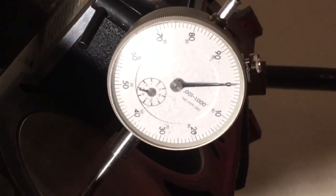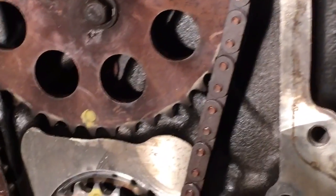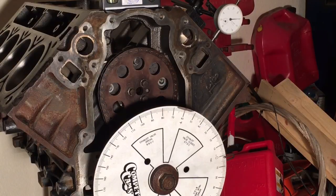Here's my dial indicator set up on the piston, and that's at a true measured top dead center, dead on. We've oriented our degree wheel to zero at a true top dead center. Basically, all you have to do is bring your two dots — your dot on your cam gear and dot on your crank gear — together like you normally would. Set up your dial indicator right on top of your piston, as close to the center as you can, so you're not subject to movement on the piston pin. Mess with your crank until you get an absolute zero top dead center — if you move it any direction it goes down — and you center it. Then set your degree wheel at zero. I have a pointer on the right-hand side, straight over zero.